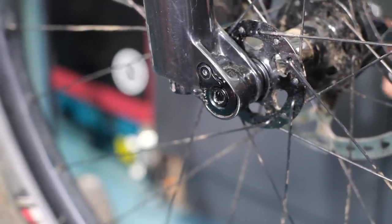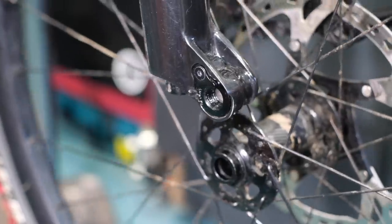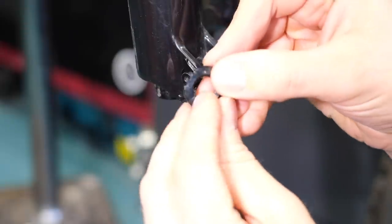I've lost track of how many times I've seen people wrestling to get one of their quick release axles out of their forks or the back end. After a while these things can get pretty gunked up. People put them on the floor where they get mud on them and then try to slide them back in, sometimes nearly hammering them into place. These axles should slide in really easily. If yours isn't, remove it from the bike, clean it, make sure it's working. Some axles have got moving parts like the cam — treat it to a bit of lubricant. Clean the inside of the hub if you can, then put a small amount of grease in and slide it back through. Check the threads are clear on both your fork and the frame at the back end.